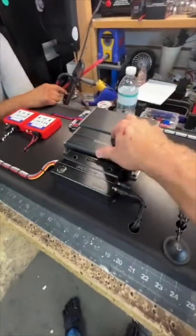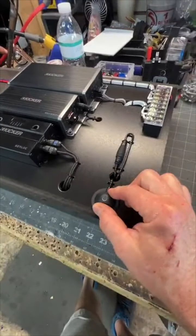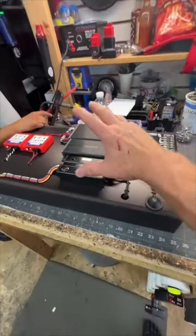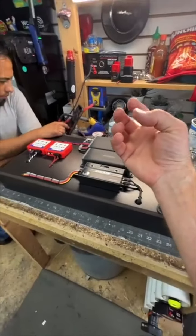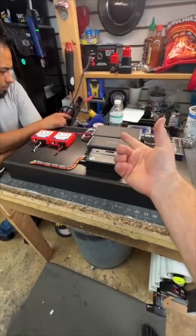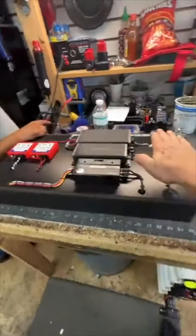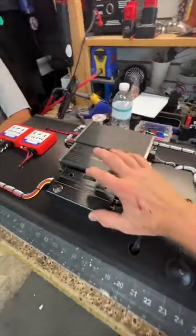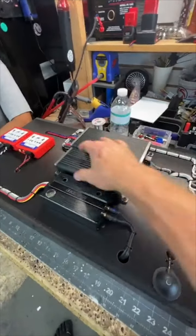Now what this is doing when you hook it up to your aftermarket radio, it is using this microphone to play its test tone and re-EQ the system. It is not going to fix any factory time delay, any all pass filters that might affect the imaging of the car. It's not going to do any of that. So this came out first. It's really cool, awesome tech.